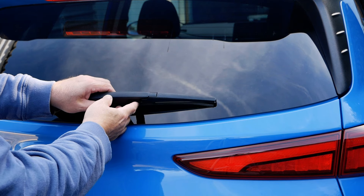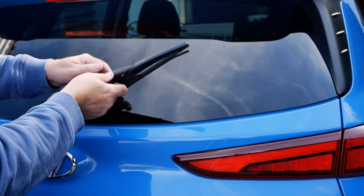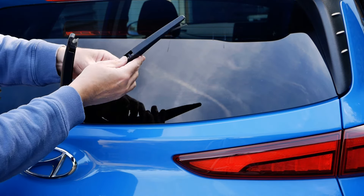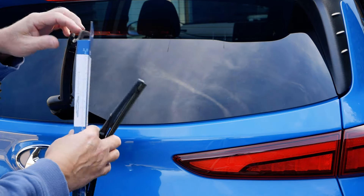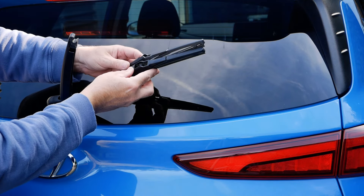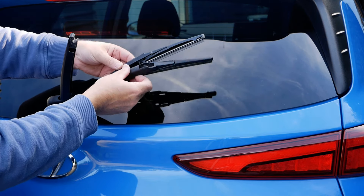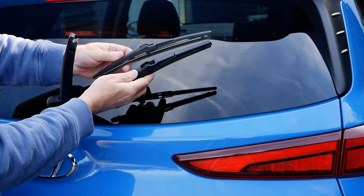When it comes to doing the rear they are a little bit different. You can see the wiper blade is torn on this one — this car is now three years old, has done 22,000 miles, and clearly needs changing. To remove the rear wiper, lift up the wiper arm and turn the wiper blade so it's at 90 degrees to the arm, then snap it out of its position. You can see how they mount — it's just a plastic spindle in there sitting within a cutout. Check that your replacement wiper matches: the cutouts can differ and the size and shape of the mounting spindle can differ too. But this Bosch one is absolutely identical to the original — I suspect the original is also a Bosch one.